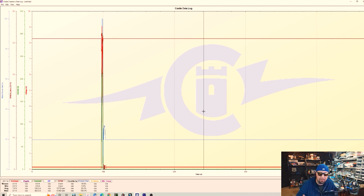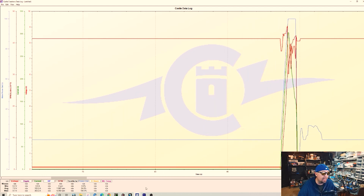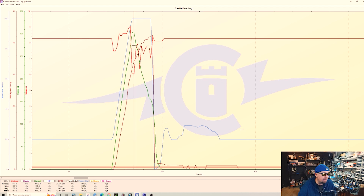So I was applying my cheat timing range at really crazy levels — trying to put in either 6 degrees or 45 degrees within a small window — because I thought my car was only making 20,000 RPMs when in actuality it was making 42,000. If we zoom out and look at the logs from yesterday, things look a lot more normal and settled in. You can see the RPM range going up to 42,000, and most people say around 50,000 is where you'll end up with this car.